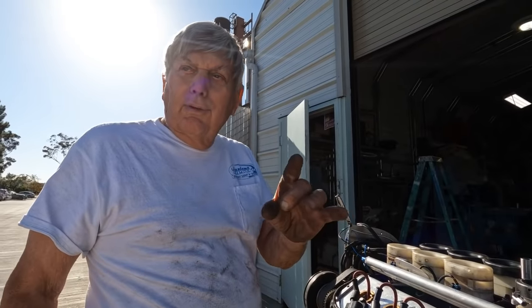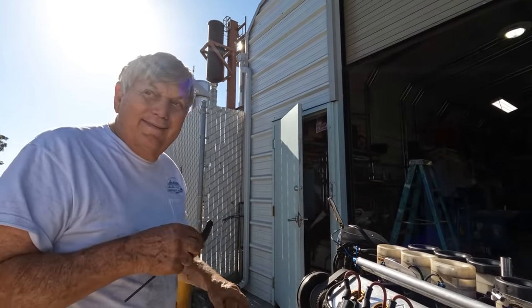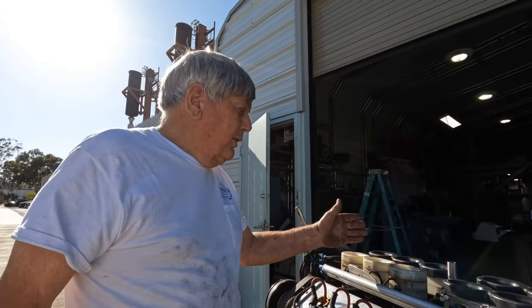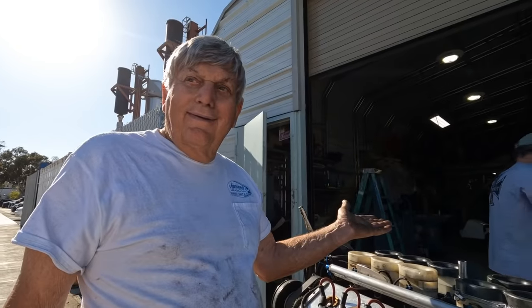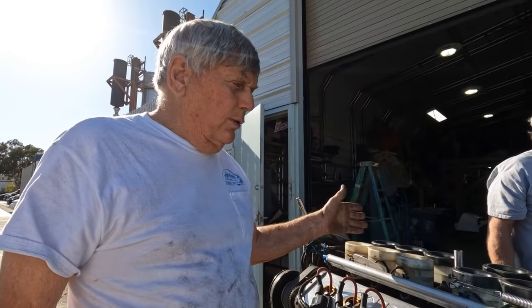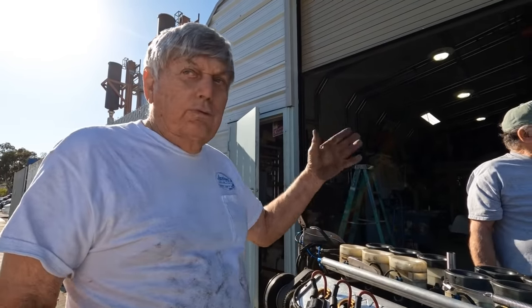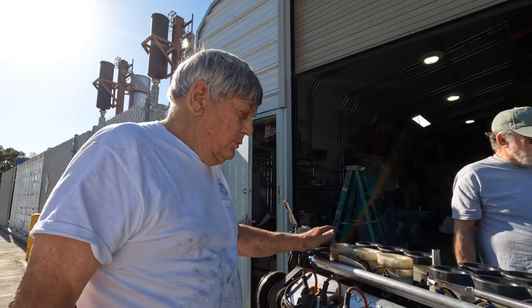The problem is that when you're trying to accelerate, you don't have enough air. Yeah. Because you're only going 100, right? That's when you get up to the top end, that's when it'll change. Yeah, so you almost need a gate that'll open according to the speed or the throttle input, right? And then when you get to full speed, it closes. And you get a constant. The other way to do it, just block it off. Yeah, just let it run off atmosphere.